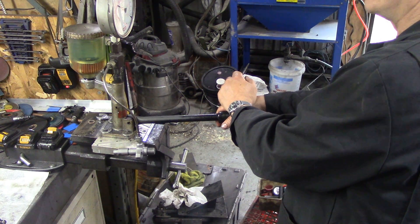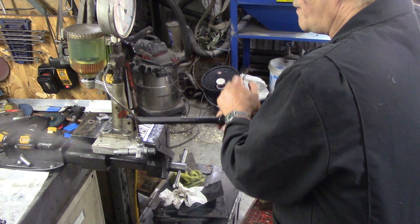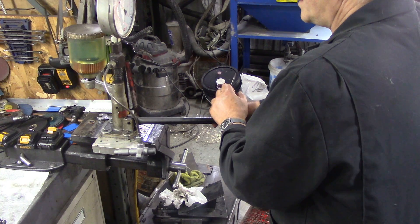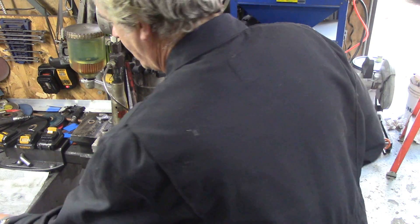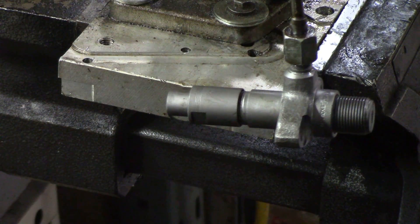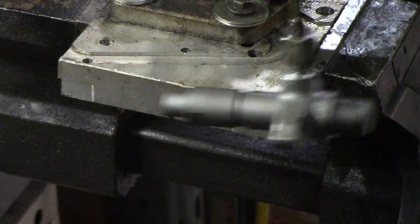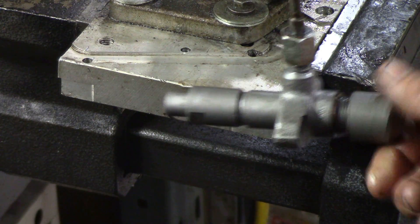Let's try it again — let it drop down a bit. 100... 120... 125... 137 — on the money, 137 — a good spray pattern. It has got a little bit of a jet but you can see it's not dribbly and there's no jets of fuel going the wrong way. That's a good one. I might even take my forklift injectors out and have a go at them.